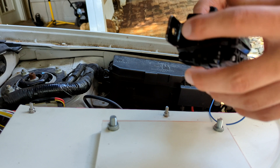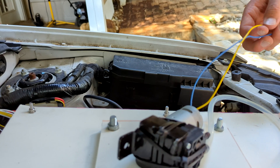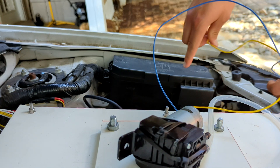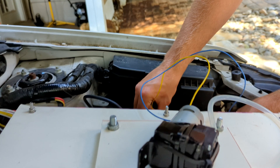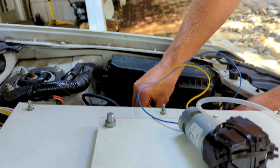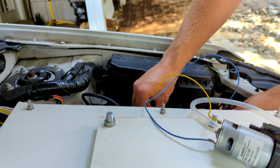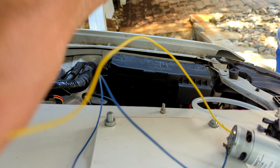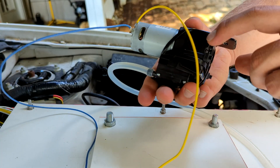Here's the pump. It's connected to this little mount I made so I can bolt it to the car. I'm just going to hook these two wires up. It seems the polarity doesn't matter for this vacuum pump. I've got my 12 volt battery right down in here and I'm just going to touch the leads to the battery. You can hear it. It's pretty noisy and it vibrates quite a lot, so I put some rubber padding inside this mount so that hopefully it's not as loud.